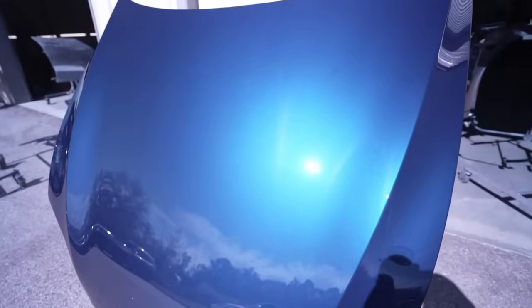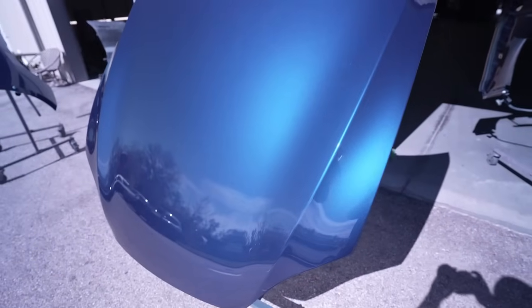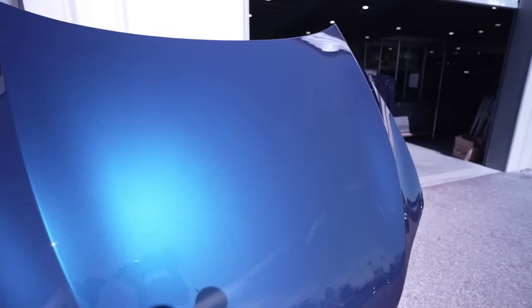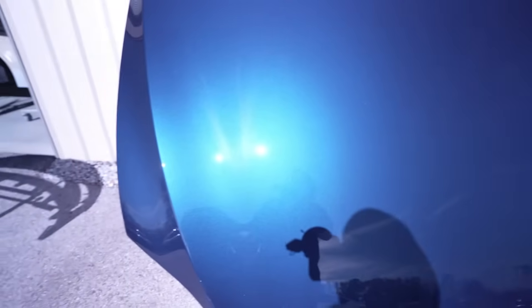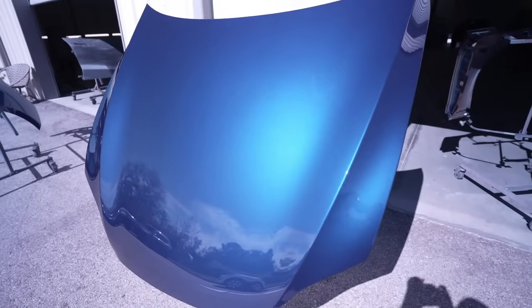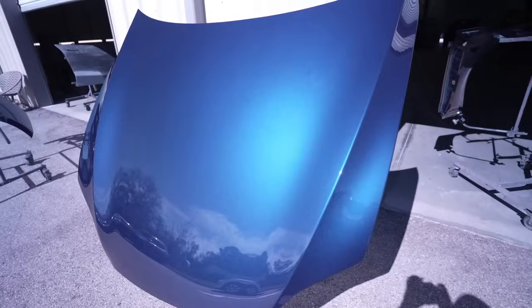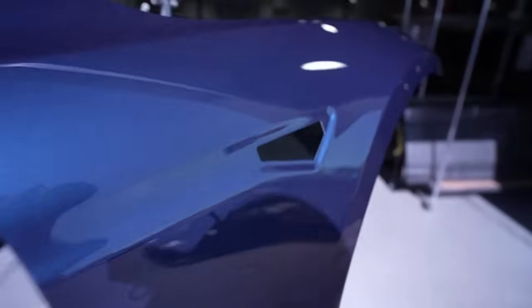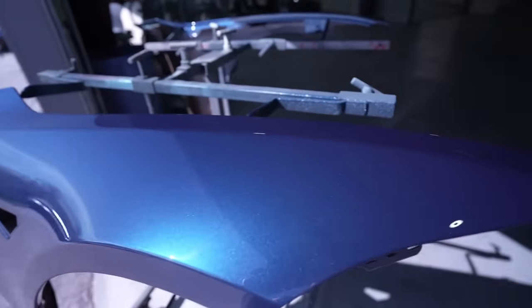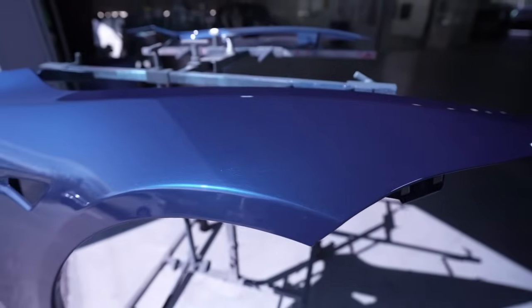Check out this clear, guys. The gloss retention on this one is phenomenal. We had a big hood, put it on nice and wet, and baked it — and we do not have any dieback at all. We're using a waterbase here, but look at the gloss on this one out in the sun. This one is definitely top of the line. I'm going to start using this more often, especially on high-end jobs. No orange peel, or very, very limited orange peel. If you're looking for that show car look, this is going to be the clear for you.